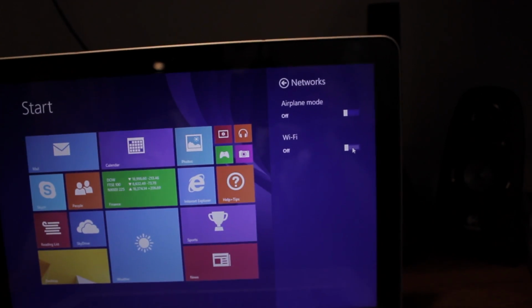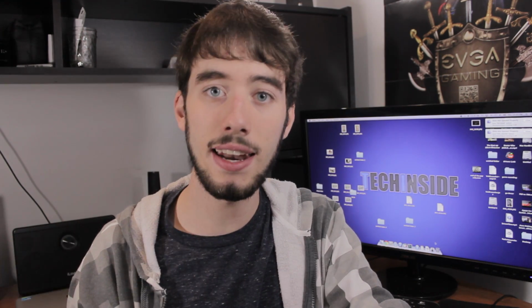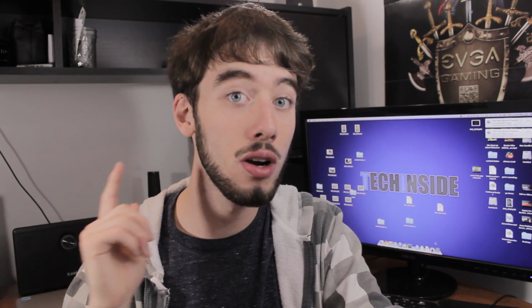Regardless of those technical aspects, how do you actually make this device work? Well, it's specifically made for Windows, so if you're running Windows 7 or Windows 8, you should be able to just plug it in and it should work automatically. Anything lower, it looks like you need the disk. The Kinivo WID340 comes with a little CD with the driver on it, so you can install the driver if you need to, but in my experience, if you're updated with Windows 7 or if you have Windows 8, the drivers are already pre-installed, so just plug it in and it should recognize the device and work perfectly fine. According to Kinivo, there's no support for Mac or Linux. I did try it on my Hackintosh as well as my MacBook Pro, and I could not get it to work, but on Linux, specifically on Ubuntu, it worked perfectly fine. Just plugged it in and bam, I had Wi-Fi.